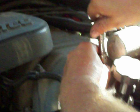Now to top off the coolant, how much do you know to put in? Just fill the radiator back to the top, because then the reservoir tank is still full. Okay. We didn't lose any out of there. Is that straight coolant or is that coolant and water mixed together? We use premix solution. It's water and coolant already mixed. So we have to fill it into the cap right here, or into the overflow container? In here. But we have to wait on that because it's too hot. Don't open that up when it's hot, because if it's boiling it will spray out at you and you will have to go to the hospital.